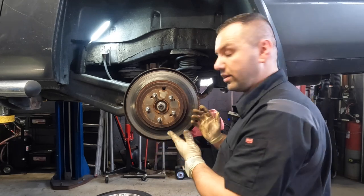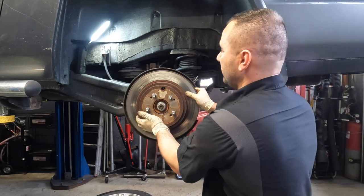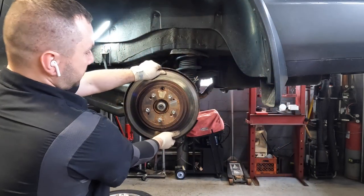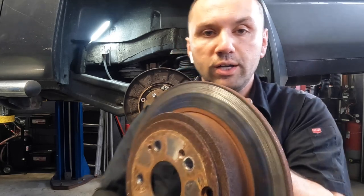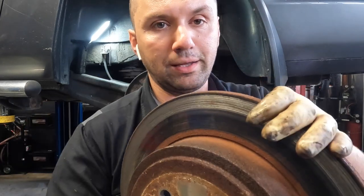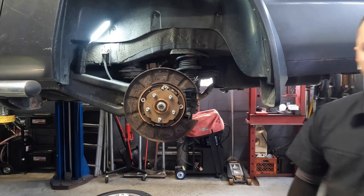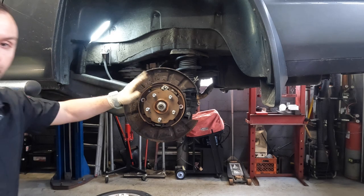Once you get your caliper out of the way with the bracket, what you'll find is that you have your rotor left. Typically you want to knock this off. My rotor looks like it will come off - this is a very nice garage-kept car. Just by wedging it back and forth, I'm able to remove my rotor. You can see the extent of the damage there - they ground it, and it's really weird because it only ground to one side. I think that piston cocked and locked the outer pad in, and that's why we created all of this mess. You can also see this car has an encapsulated brake drum design for the parking brake shoes.